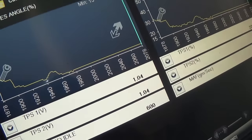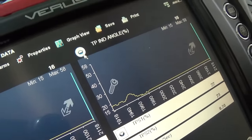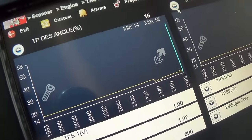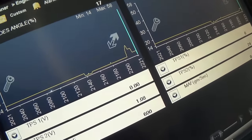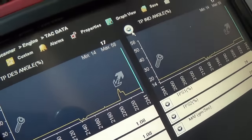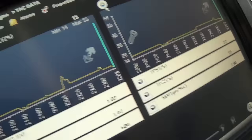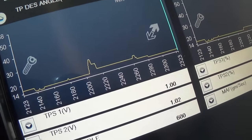So just in drive, standing still, our TPS 1 and 2 voltage are at 1.04, which is about 15%. Put it in park - there we go - 1 volt on the money. So we don't need to clean the throttle body. That'll save the customer some money. If I shut it off and turn it back on, at startup we're at 17%. Our desired idle is 600 and we're right where it's supposed to be. We're going to call this one a fix. Thanks for watching.